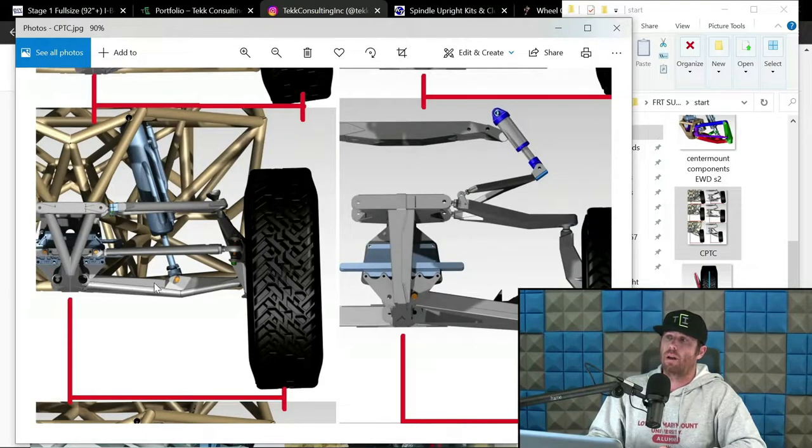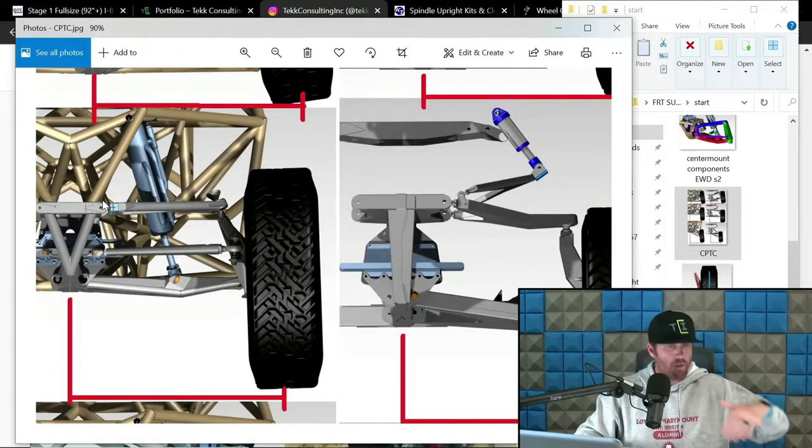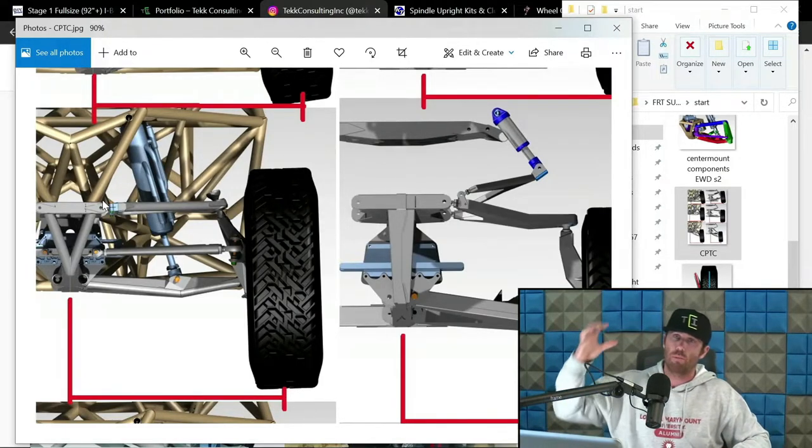And then you're going to have this line right here between these two points. You're going to draw it at 90 degrees, and then you're going to kick it inboard 5 degrees and draw another line. And that'll give you some point right in this range. It usually always ends up in this range to some degree. No pun intended. And that's a good starting point. And then you can start cycling your suspension from compression